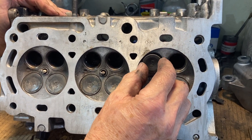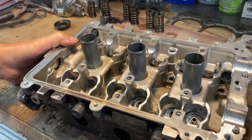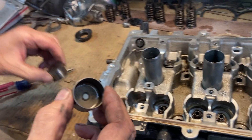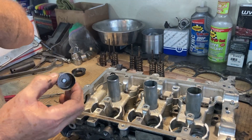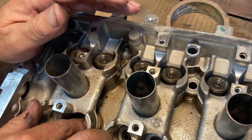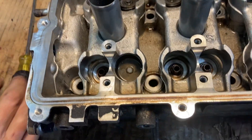It's not a hard process to do, but let me show you how I do it to make things a little bit easier. First off you've got to know how deep to set these guides. What I do is I start with a couple of the buckets - the valve adjuster buckets. If you're going to use the ones off the head, don't mix them up because otherwise your valve adjustment might be out. Put the first one in upside down, all the way to the bottom. Take a screwdriver and tap it to make sure it's down, then take a second bucket and put it in the right way up.